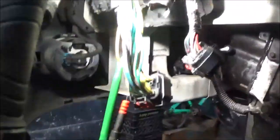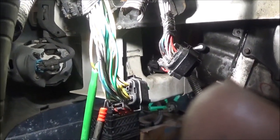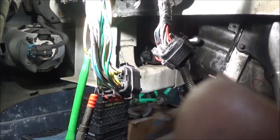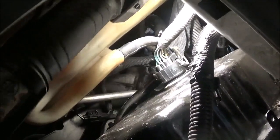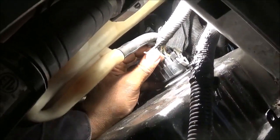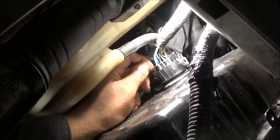This problem is either something wrong with the wiring going to the solenoid pack, or something wrong with the solenoid pack itself. So the next step is I'm going to trace the wire — that dark blue with the yellow — right to the solenoid connector. And when I get there — oh, I see the problem! That's not a shift solenoid issue — it's a broken wire at the connector.